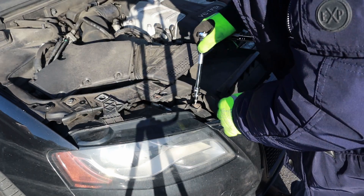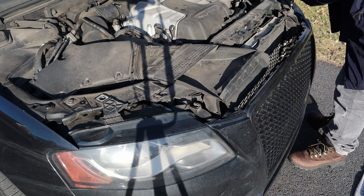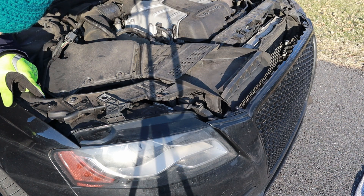So we have this bolt here removed. There is another bolt back here next to the intake housing. Just make sure when you're loosening those up, you don't pull them out all the way, unless you feel like spending a lot more time trying to get them back in. You can just loosen them up and the headlight assembly will slide right back into place. It's extremely narrow over there, and even with a magnetic tip on your T25, it's still going to be a pain. So just don't take them out.